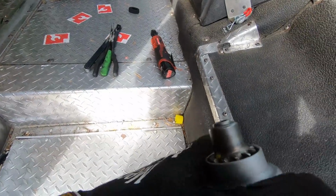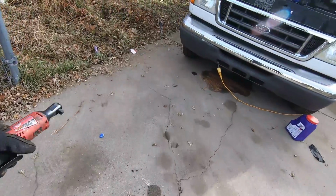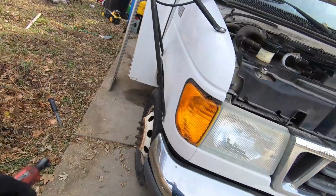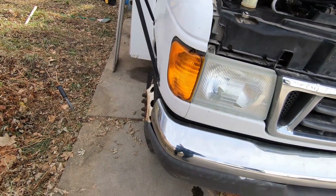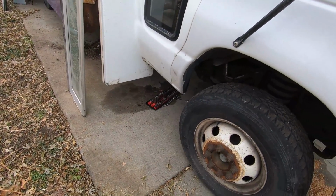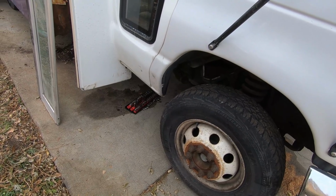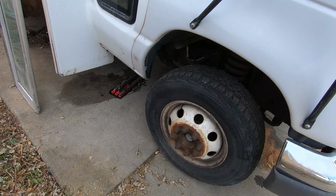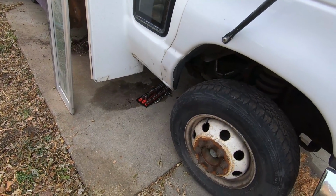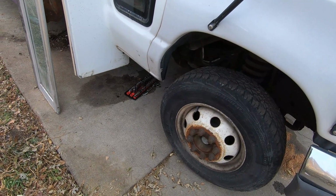I didn't actually show you the video when I hopped up in the truck finally, and the batteries are charged. I was going to start it. Same thing. I put the key in the on position. I could hear the solenoid overhead for all the accessories clicking, because it'll divert all the power to the startup. So it was clicking, but it wasn't cranking anymore. So I got out, took it in to get tested. Halfway through the test, it did kick out, but it still failed the test. So at least that's good to know and easy to pinpoint.